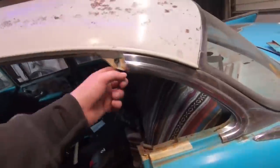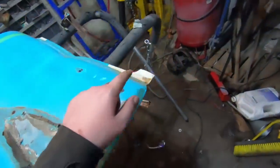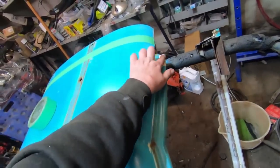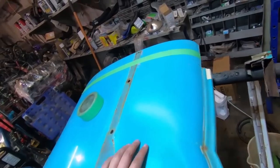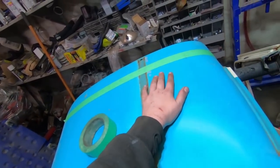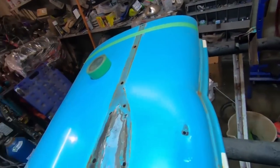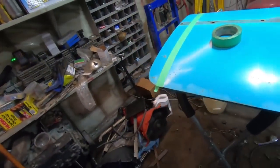I got bored after supper and came back out to the garage. I cut that little piece out and got the inner structure of the door — I cut the top of it off because I'm obviously going to have to section a piece of it out. I kept as much material as I could where I'll do some miscellaneous work. I'm going to cut about four inches off. I measure it at about six, but I like to eyeball it. Then I should just have a skin I can kind of overlay on the car to get a good idea of where I'm going to be.